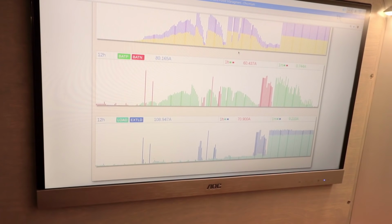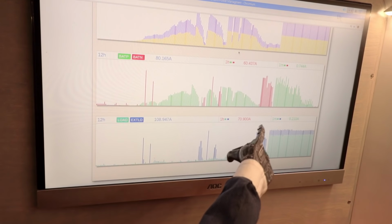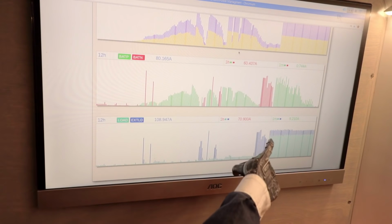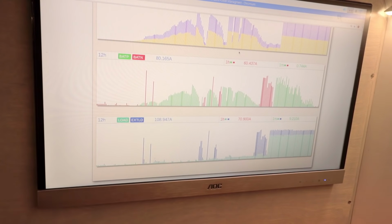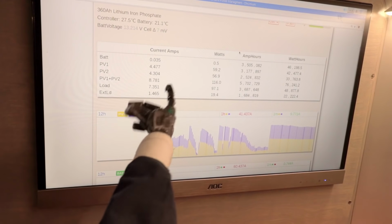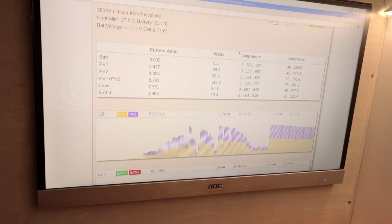Alright, so the Instant Pot just got up to pressure, and as you can see on our battery load chart here, it just spikes to 800 watts there, 750, 800 for that short time, and then once it reaches pressure, it's basically using no power. We're down to 1.6 amps on the inverter. So that goes to show you that it's not 800 watts for an hour. Most appliances are going to cycle in and out and use less power than that.